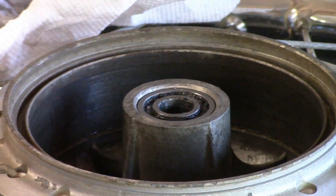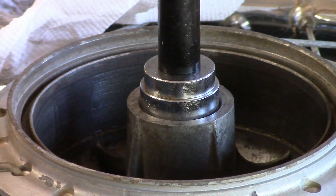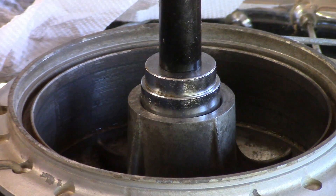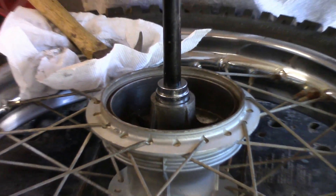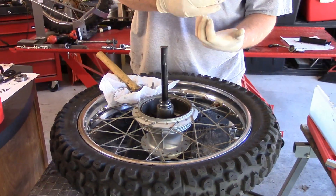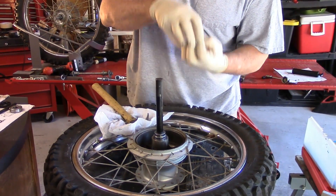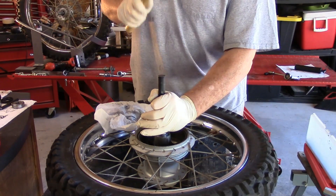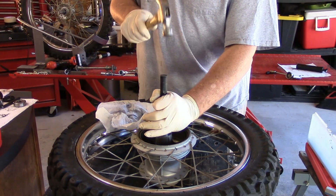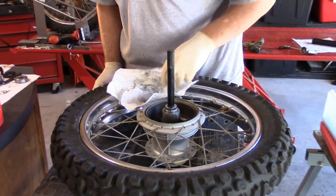I have selected a size that will go down inside the hub but cover the outer surface of the bearing, which is the immediate surface that I'm hammering on. I don't want to do it on the center — I want to do it on the outside. That way I'm putting the force on the exact surface that is resisting the installation. You can hear the difference. That solid feel tells you it is all the way down.